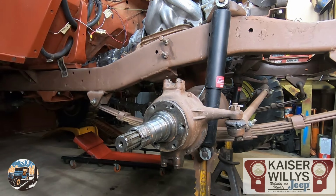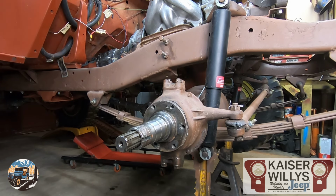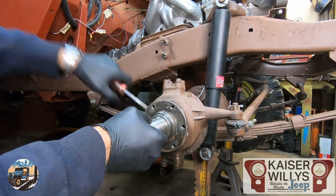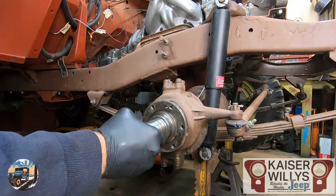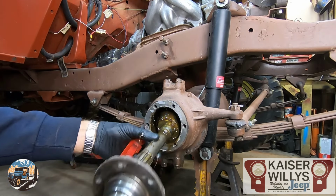Depending on what kind of lubricant the previous owner put in the knuckle, if they just put straight gear oil in it, you're gonna have oil coming out. Keep that in mind as you remove the spindle. Other than those 6 bolts and the gasket, there's nothing holding it to the knuckle. Keep pushing in on the axle so you don't lose the balls in the U-joint.